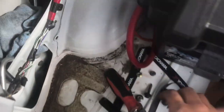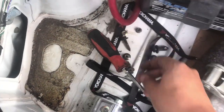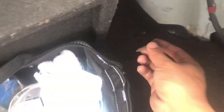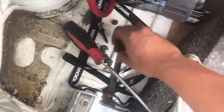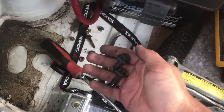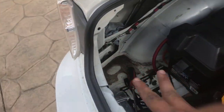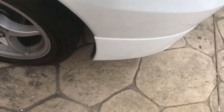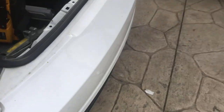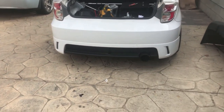The bumper is ready to take out. The reason it took so long is because they put long screws down there on both sides. The bottom ones I had to get on the ground for. There are two right there, two right here — and I also took off the ones from the mud guard since they're on the bumper. Should come out pretty easy now.